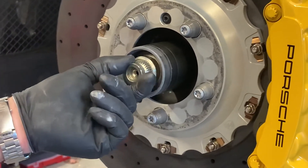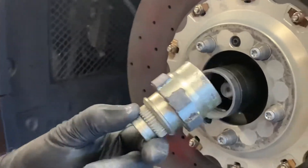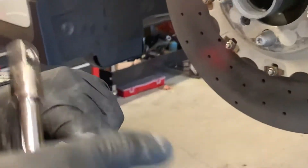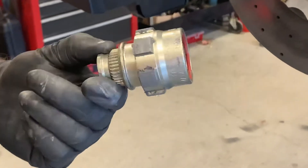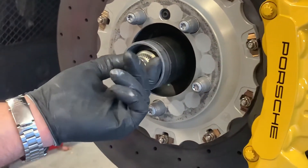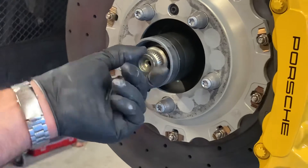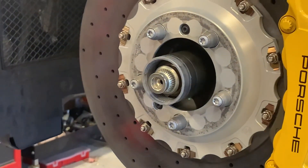If you're having trouble, I recommend removing your lock pin assembly like this, checking all these surfaces, making sure you don't have any rust or gunk that's preventing it from rotating, and then you can lube it back up again and insert it back into the hub assembly. Just make sure with your hand that you have that free rotation there that you need to make the lock pin engage.